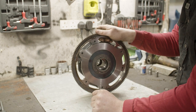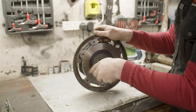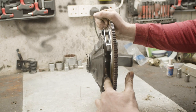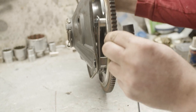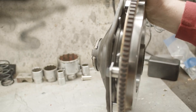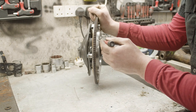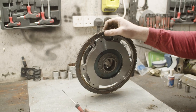This plate is trapped and caught onto the flywheel, meaning that as the flywheel turns it will turn. In order for you to be able to engage gear in your car you need to release this clutch plate to allow the gearbox to freewheel. How that happens is a bearing called the release bearing presses here on the diaphragm and compresses the spring. The spring is this kind of bevel plate in here — that's the actual spring. When the clutch release bearing presses on the outside of the diaphragm it compresses that bevel plate, pushing this forward, releasing the clutch plate, making it no longer part of the flywheel and allowing you to get the car into gear.